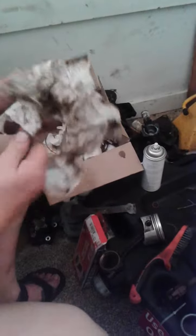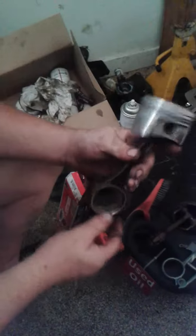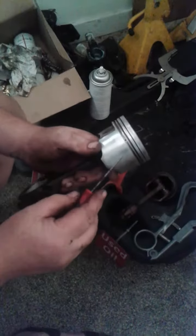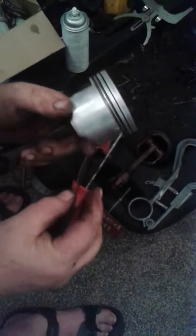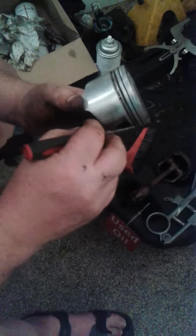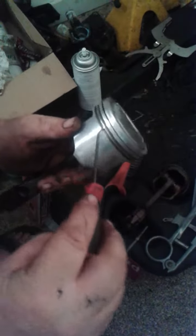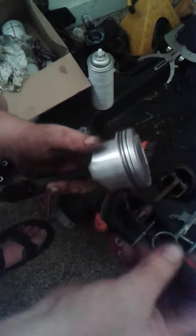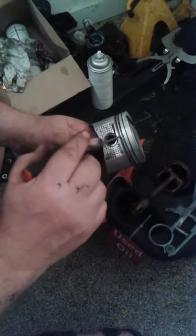What we have here is a piston — this one we've started to clean. We have lands which sit in the back here. The bottom of a ring groove on a piston is called a land. In the bottom land, which is the oil control land, we have oil return passages that you have to find a device that will go in and clean the passage out of any congealed oil and carbon build-up, once having removed the rings.